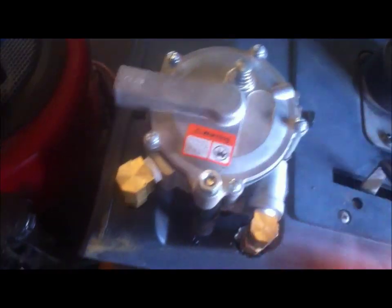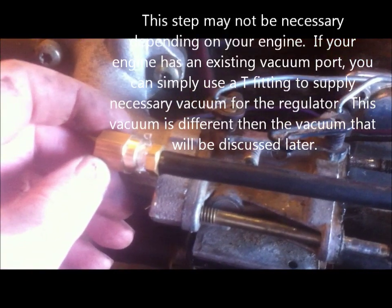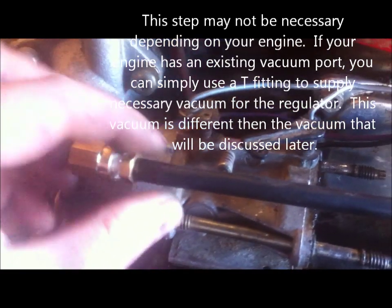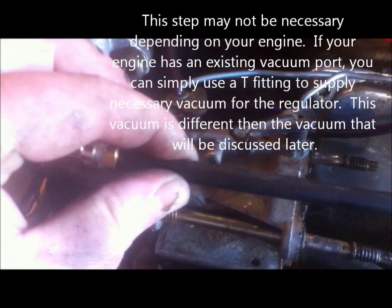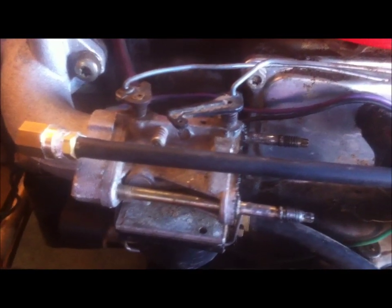Here's the starting primer. And over here are the modifications to the engine itself. This is the intake manifold. I drilled a hole and tapped it out with 1/8th NPT and hooked up a 1/8th inch nipple here to run the vacuum line. What this vacuum line does is act as a safety — when the engine dies, the propane flow stops.